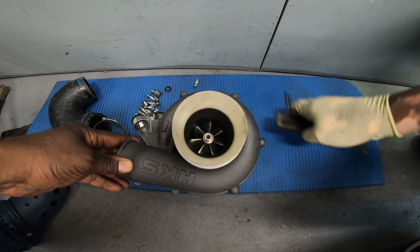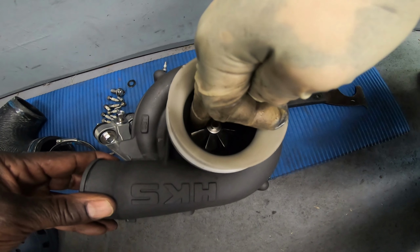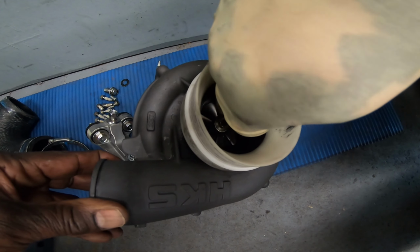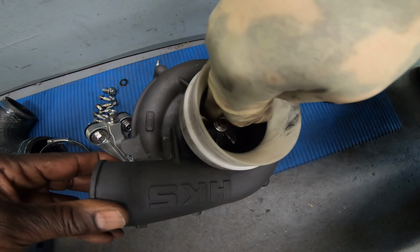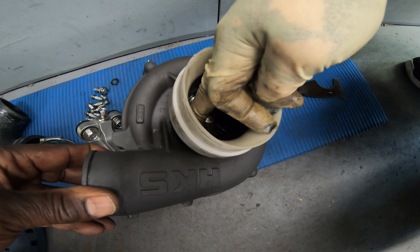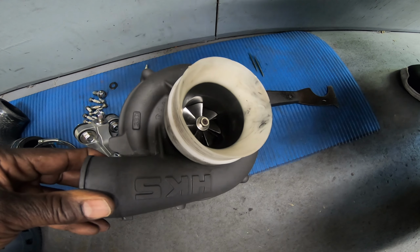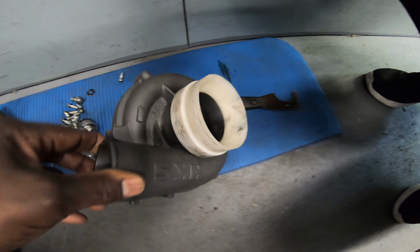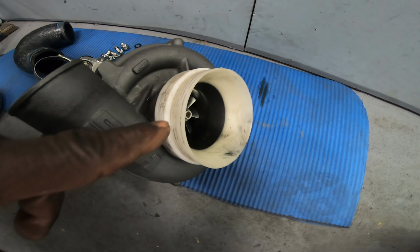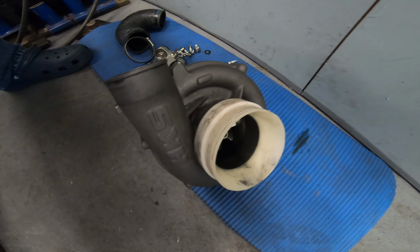The way to know that you need to replace your bottom clutch gear is that your supercharger should spin one way. If your supercharger spins both ways, then you know your clutch gear is bad. Counterclockwise, it should not spin. Clockwise, it should spin. So if it spins both ways, you know your supercharger gear has gone bad. And you don't have to take it out to make this discovery. All you have to do is take this air tube off of the front and stick your finger in there with the jet ski not running.